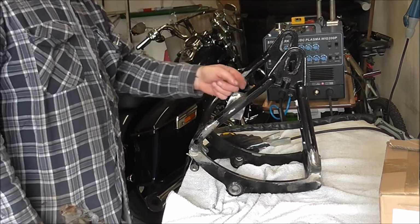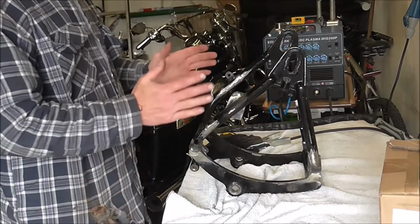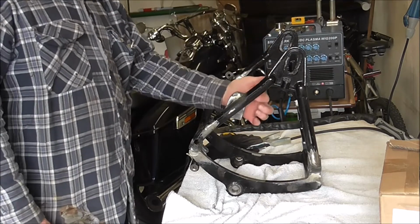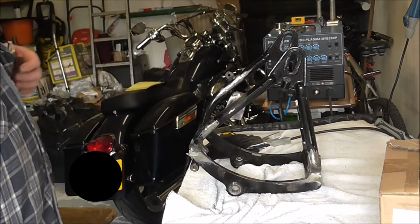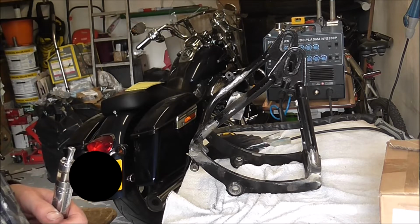But yeah, fully welded round the bottom, incorporating the original bracket, which should help keep it from moving. And then 3 half-inch-ish stitches across the top, and that's more than enough that bracket needs. So I'll knock you off for now and let it cool down, and then I'll bring you back. Okay?